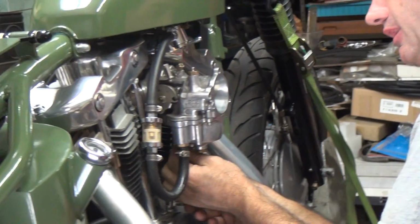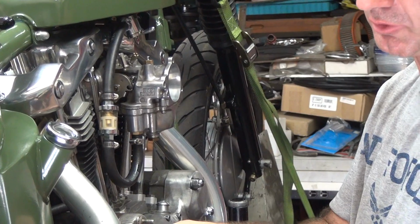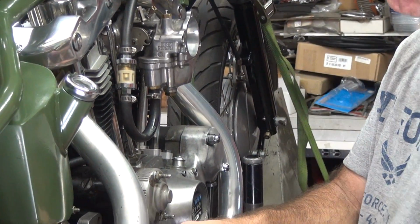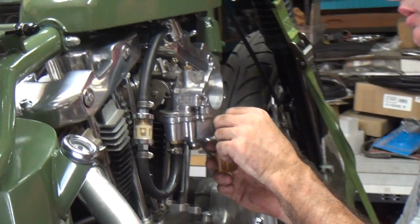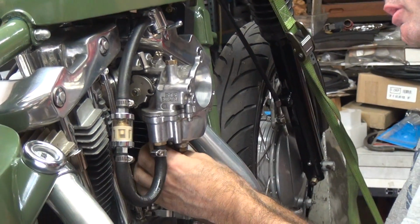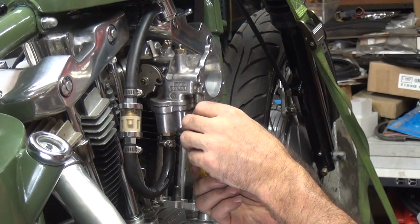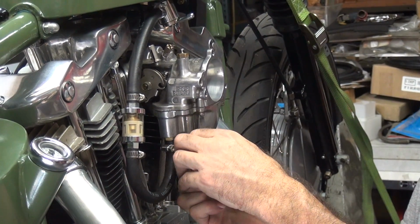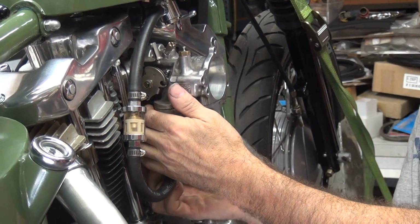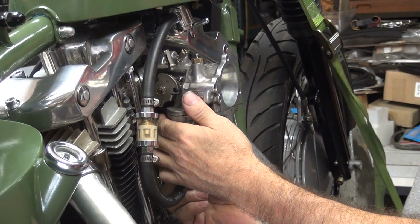So you're faster in a 1/4 mile than a mile? Well, at Bonneville you time between 2 mile and 3 miles for your mile. And in a 1/4 mile they give you a 1/4 mile time strap, so it's from 2 to 2 1/4. So you got 2 miles of build up for that 1/4 mile. So I'll have a higher speed going in, but the motor will blow up before it gets to the finish line. I'll coast through the last 1/4 mile. I've coasted through half a mile where I blew up at halfway. I'm still around 135. And at that speed you decelerate pretty quickly, so you probably do around 158 or so when it blows up.